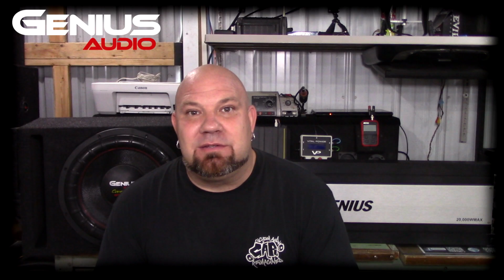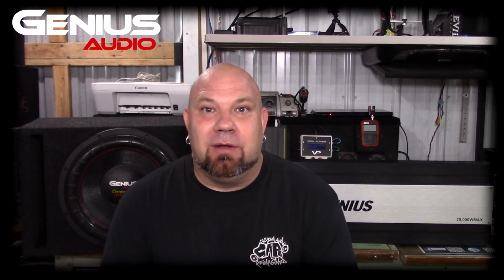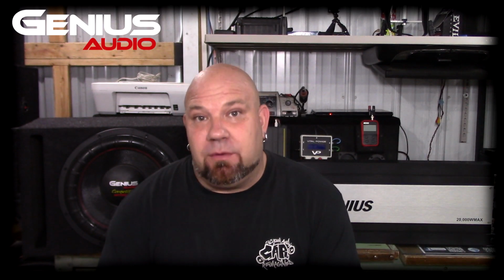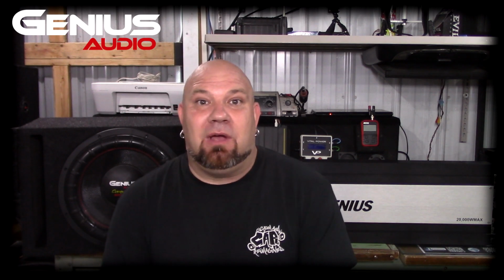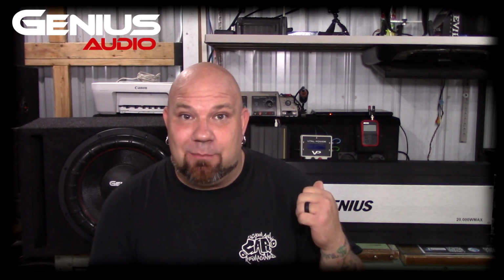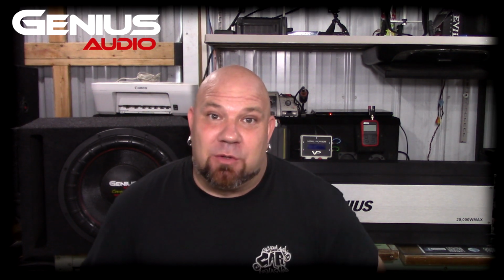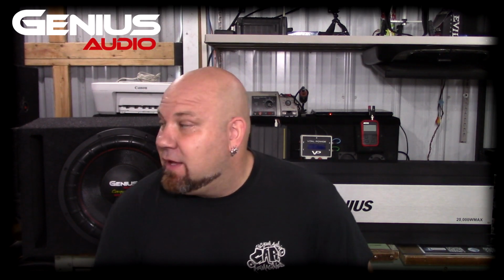Both of these products are for competition. These are competitor series equipment. If you run DB drags or anything like this, this is what you'd want to run. Now, doesn't mean you can't use them in your daily driver. It just means you're insane if you do. And just know, if you want to use this amplifier in a daily driver, good luck, because your electrical system better be on point. That amp will draw well over 1,000 amps of current. So I hope you have multiple alternators, multiple batteries, and you are ready to handle what this thing does.